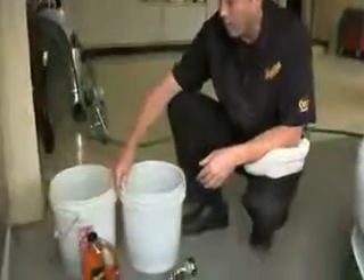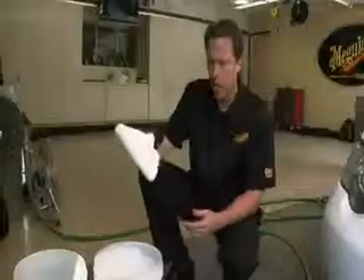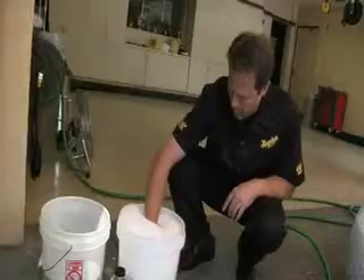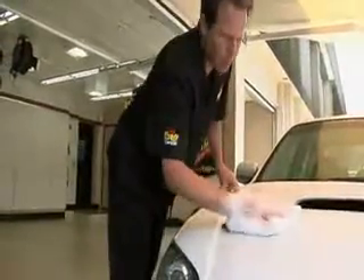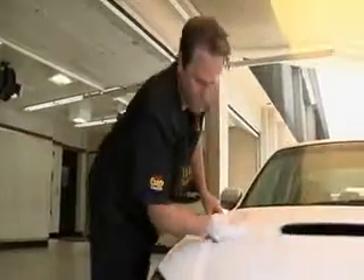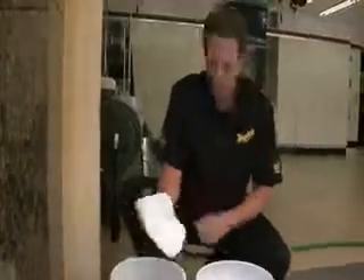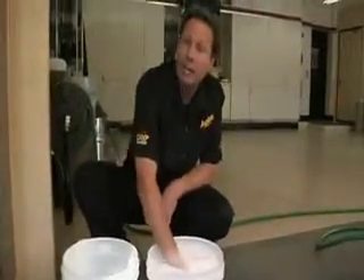Now that we've pulled the car, we're going to actually wash it to remove all those contaminants. We're going to be utilizing two buckets here. You're going to dip your microfiber wash mitt, and as you begin to wash that car and your mitt gets loaded up with bugs and dirt and debris, you're going to take this mitt, go back to your plain water, rinse the mitt out, then come back over, pick up your clean wash solution, and go back to the car.